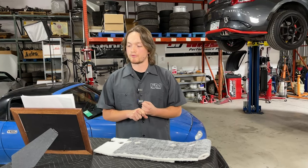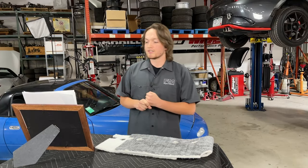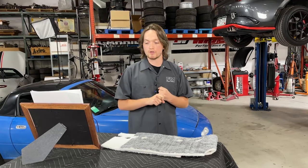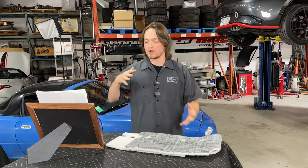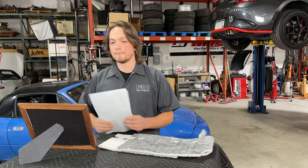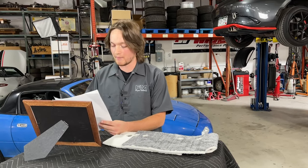For the most plush ride possible, it's generally a better idea to opt for rubber bushings rather than polyurethane or Delrin. This goes for engine mounts, diff mounts, control arm bushings, upper shock mounts — you name it. Jack your car up and start poking around your suspension. Check for ripped boots on the ball joints, wiggle and shake things, tap with a mallet to track down any bad ball joints, tie rods, or something in that range.